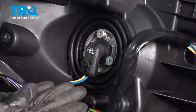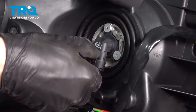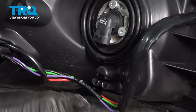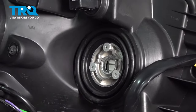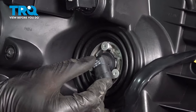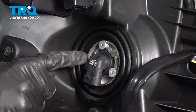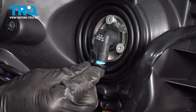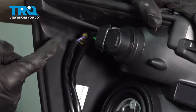To get the test bulbs out, it's going to be pretty much the same process as removing the originals. Come underneath the tab, pop that off, grab that bulb, turn it counterclockwise, and set it aside. Now you can install that new bulb — have it in a counterclockwise position, kind of diagonal, then turn it so it's straight up and down. It should be locked in on all three ears. Connect in the wiring harness. The process will be the same for the rest of your bulbs.